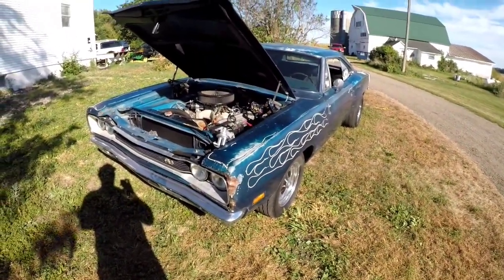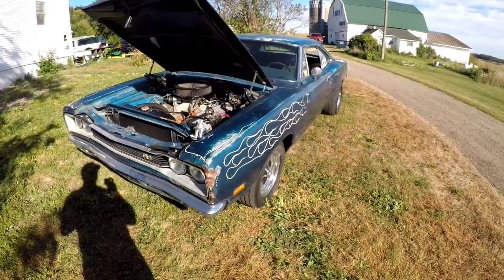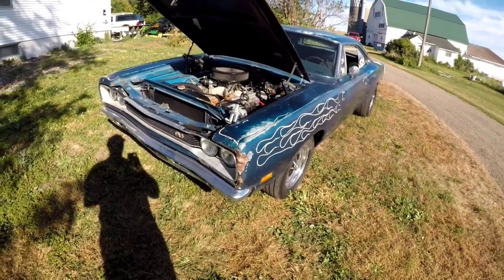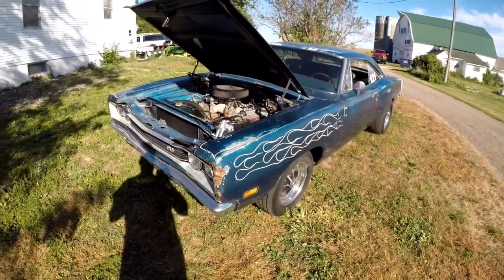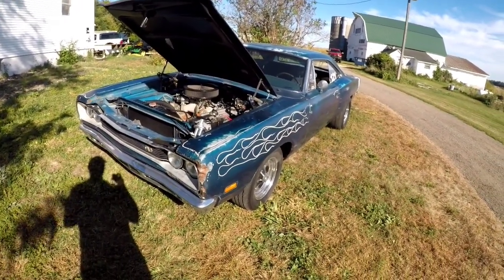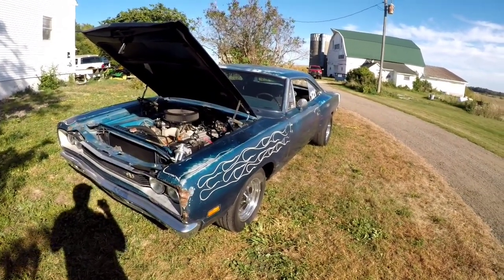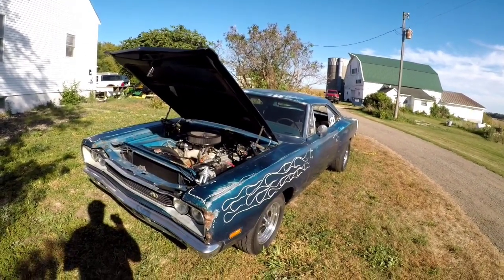When we really dug into this suspension, it needed a lot. So we replaced the inner and outer tie rod ends, the tie rod end sleeve adjusters, the upper control arms with upper ball joints, lower ball joints, and redid the backing plates, redid brakes, wheel cylinders, brake shoes all the way around, everything. And it has a new master cylinder in it as well.